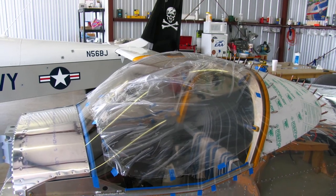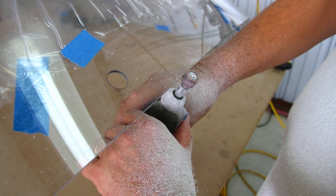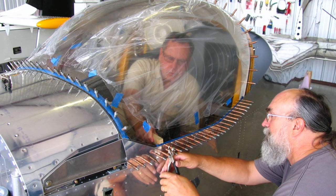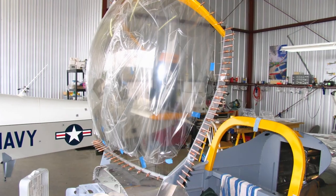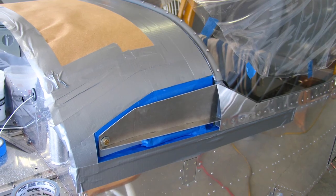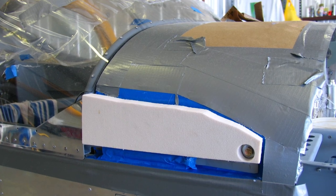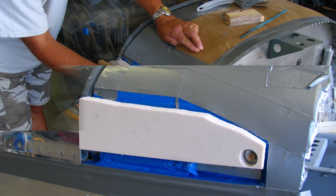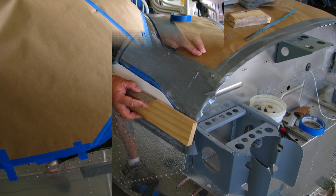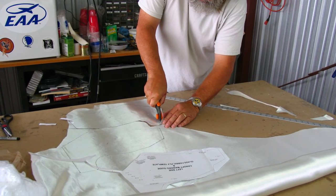We worked on matching the rear fuselage to the center fuselage, getting it all lined up, and got it ready to rivet. We worked on the control push-pull tubes. In January of 2009 we started on the canopy — we had 494 hours to this point. There was a lot of trimming and test-fitting on the canopy; it tilts up, so there was a lot of adjustment. Then we started on fiberglass — we had to lay up some foam, sand it down to the contours of the side, and then lay up several layers of fiberglass on it.